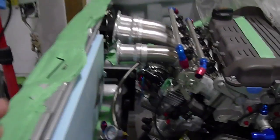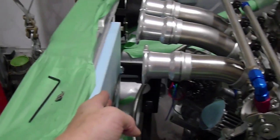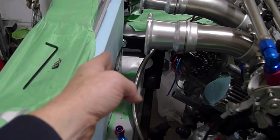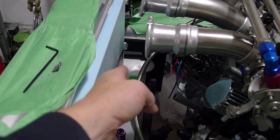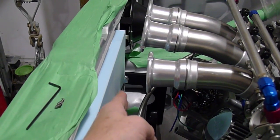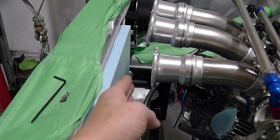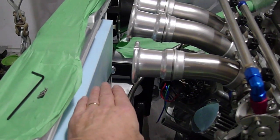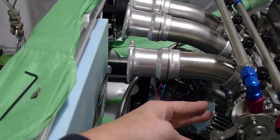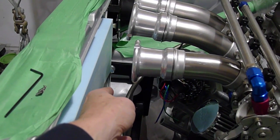I've got it all figured out. I need to be three quarters of an inch, plus another inch and a half for the fan, and then an inch and a half for the horn to the front end of the air box. It's not super critical since the fan is down below. I'm going to end up compromising a bit — I don't want the runners too short, so the air box will have a little bit of a bulge just to get around the fan.